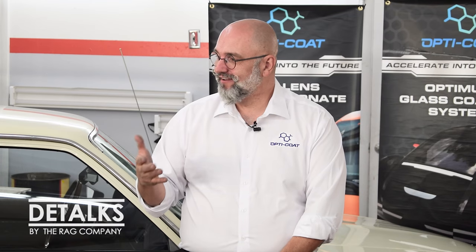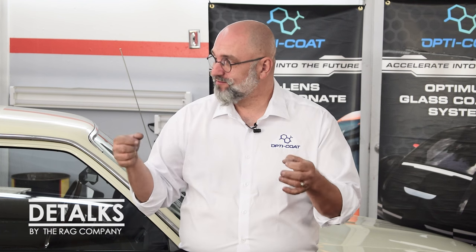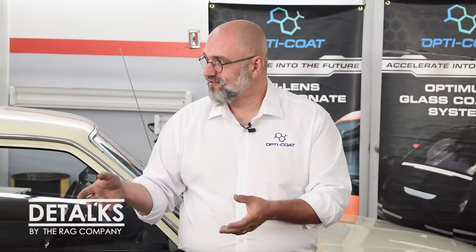In the optimization training classes that I do, one of the things we do is purposely burn an edge. I'll have one student use the polisher, no pressure, at speed 3 with his tool, and the other student at speed 6. The one using it at speed 3 goes through the paint faster than the one at speed 6. It's good to know, because they're removing paint.